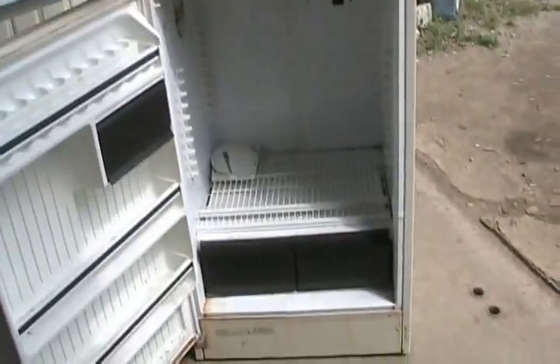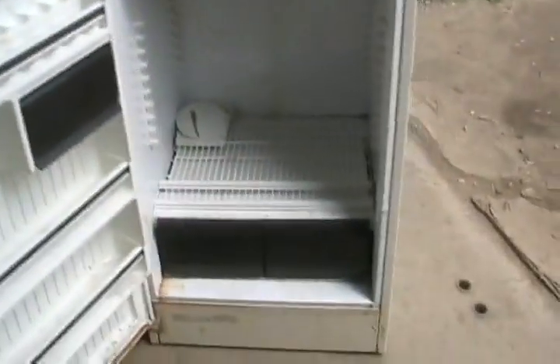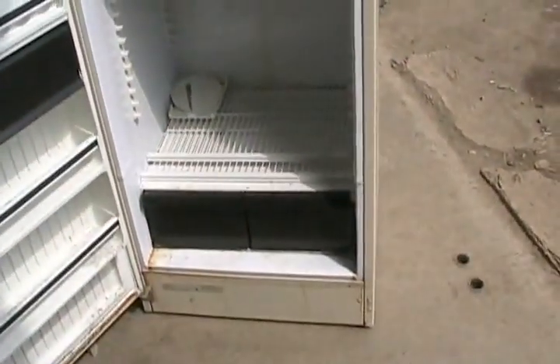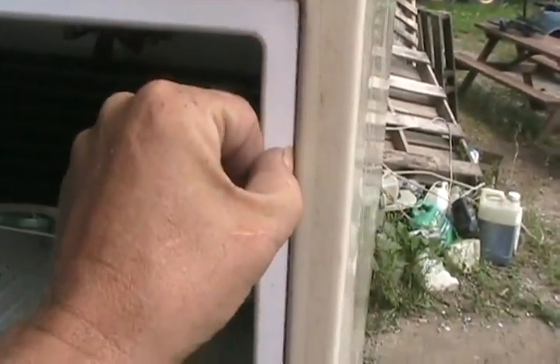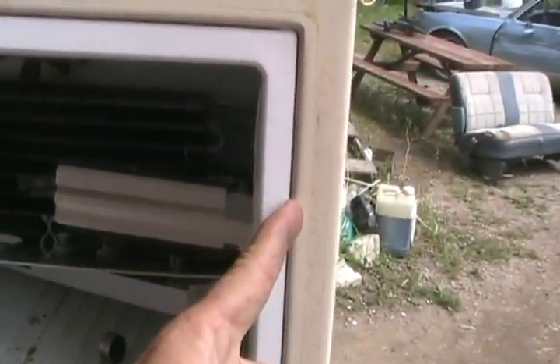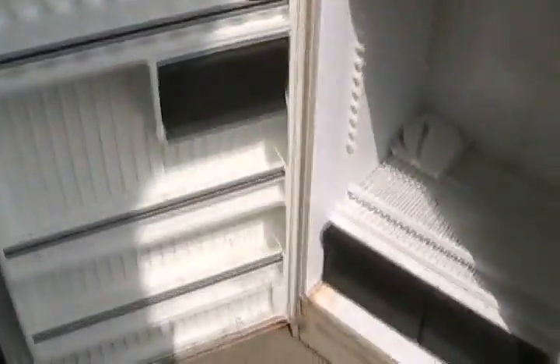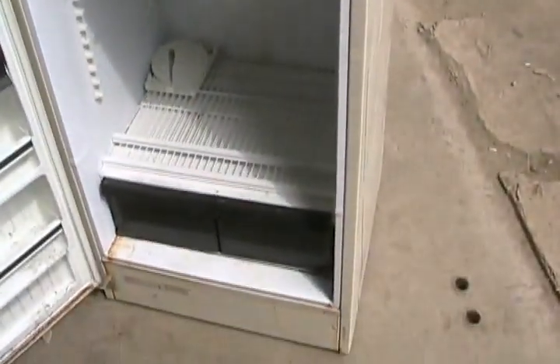Some fridge door frames get too cold and start to rust and drip. Running this tubing around the door frame uses waste heat from the compressor to warm it up, requiring no extra electricity. The disadvantage is that air gets into that space — there's often fiberglass insulation in the walls — and the insulation becomes moist, which rusts out the tube around the door frame. This is one of the most common places where fridges leak Freon, and you usually won't be able to find or repair the leak, so you have to throw the fridge away.